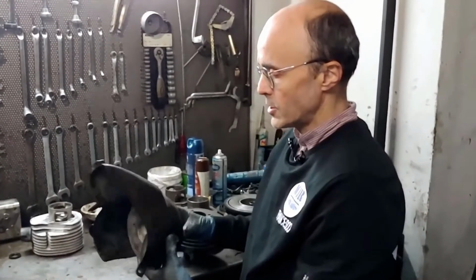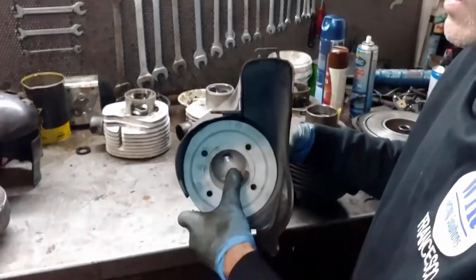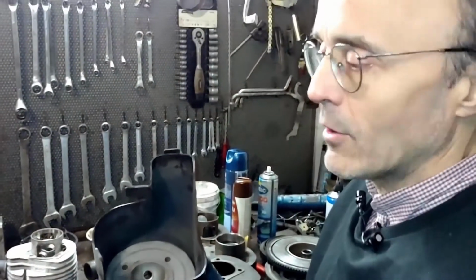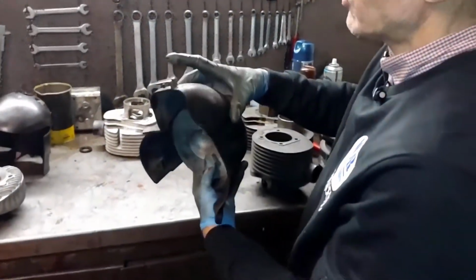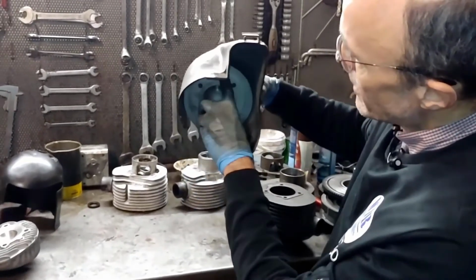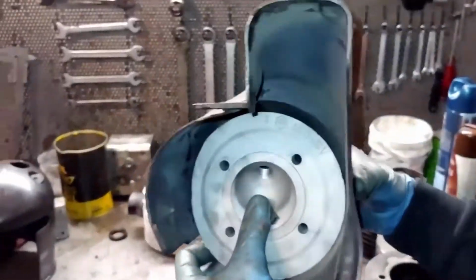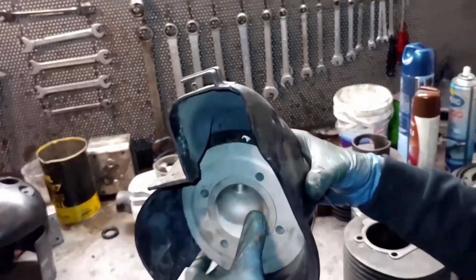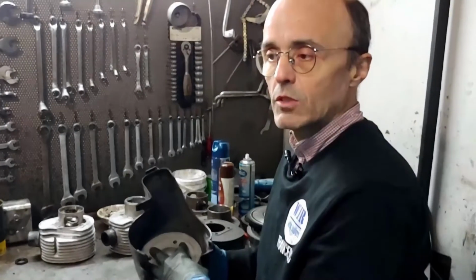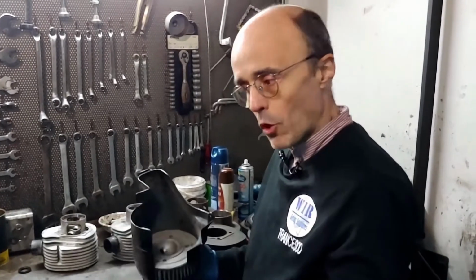We talked about the head, cap of the 200, a hint of the 125-150. The problem there is less serious, so to speak, in the sense that at the same conditions the engine is a little less powerful. The channel is a bit wider, so then eventually the fins come, and the shape is also made so that the side fins are better lapped by the flow, you see. In any case, for these thermal groups, as I said before, truly efficient heads are in production, which for the 200 are practically not available, except in the particular case of the Quattrini head, which is radial and has that shape precisely to overcome the problems which I mentioned.